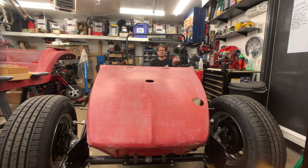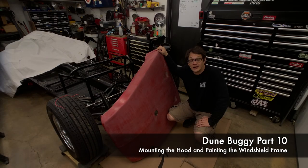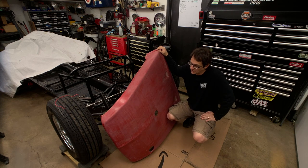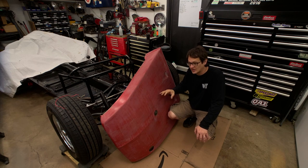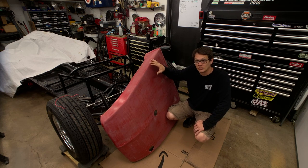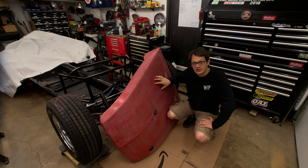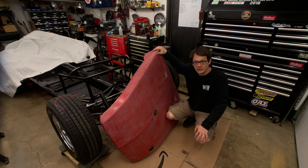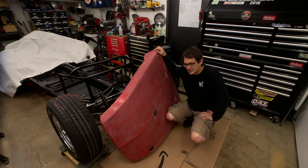On this episode of the Two-Car Garage, we're going to clean and paint this windshield frame and get the hood mounted. Our goal for today is to get the hood mounted. The hood was originally mounted with the front beam in its stock location, but we found out that once we put the caster shims in, it moved the beam out a little bit, so our brackets no longer fit.